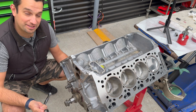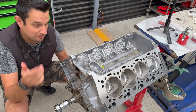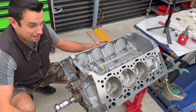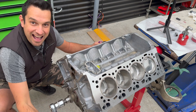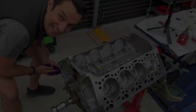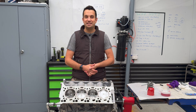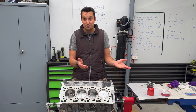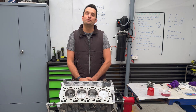Look at this masterpiece. If we've done everything properly, we should be able to crank the engine. It's obviously going to be a little heavier than normal because the piston rings are new, so there's going to be more friction on the walls — but fingers crossed, let's see if we can crank it. How good does that feel! Beautiful. Alright folks, that's it for part two of this video. Now you know how to put connecting rods, pistons, and rings onto an N63 or S63 block. I hope this video was helpful — if you're doing this sort of stuff for the first time it can be pretty frightening, but at least now you've seen it. Thank you very much for watching and I'll see you guys next time.